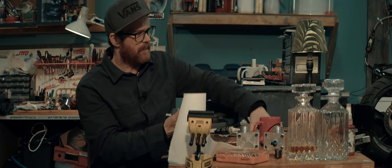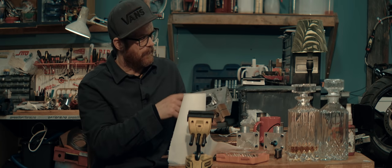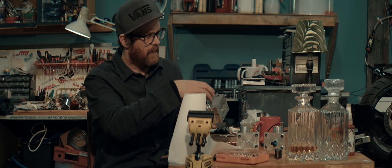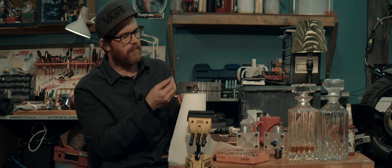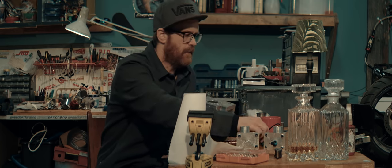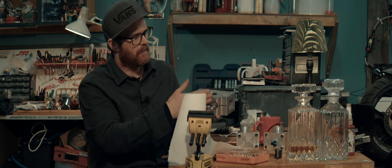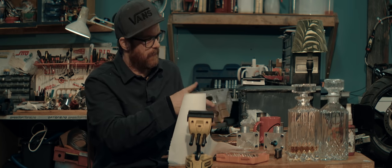I think the problem here is that there are four M6 bolts clamping this together. Then there are the additional four 8mm studs that hold this onto the crankcase and clamp everything together. I think that by disassembling and taking the top off a couple of times, I've relieved the pressure enough for this to not seal anymore. The clamping pressure provided by these M6 bolts was not enough to crush this properly. It was enough with the M8 studs, but after taking it apart a couple of times, the pressure has relieved and the gap has opened up slightly, enough to leak.